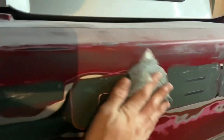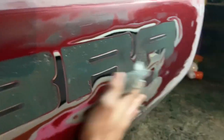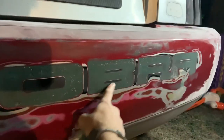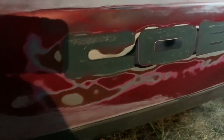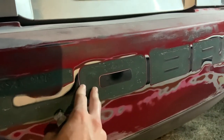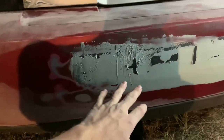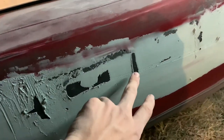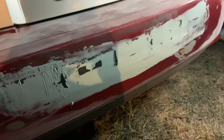After cleaning, we're going to put on some Bondo filler — not the glass this time. It's a little softer and easier to sand. Since we got most of it filled in with fiberglass for the deeper holes, the regular Bondo will handle these little tiny crevices. I just applied some Bondo but I used a little too much hardener, so it started drying up as I was trying to spread it evenly and doing this weird stuff. That's okay — we'll sand it down and add more Bondo afterwards to get it perfect.